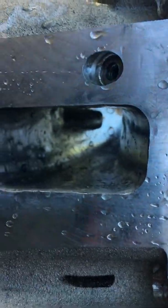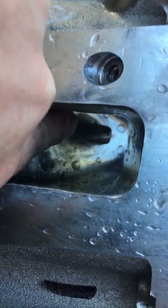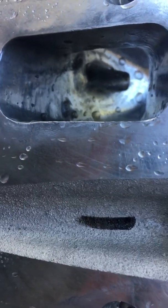There was a whole heap of flashing on the sides on either edge which I've pulled out — no flashing left anymore. There's also a large bump on the left which is largely gone down at the bottom. I left what I think is a stud bump in; didn't want to have to fill that with epoxy. There's still a bump for the spring perch which I left in as well, but I took both of those down pretty substantially from where they were before.